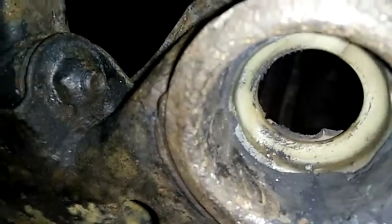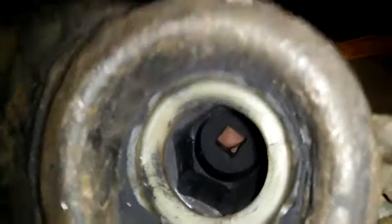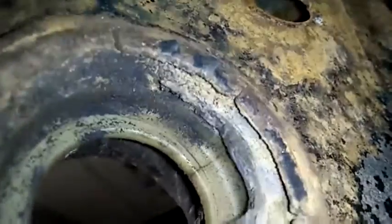So next thing I did was this. I took this, which is a 36 mil. This is what I take my axle nuts off with. Went from the bottom side, like this. There's some rubber in the way on this one, so I can't hit it directly, and it wouldn't come out anyway. And then I just pounded it out from the bottom. You're not hitting these tabs. You don't want to wreck those tabs. Apparently that's what holds that poly in there. You can see on this plastic.